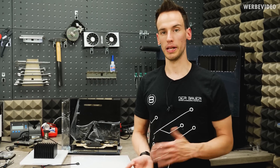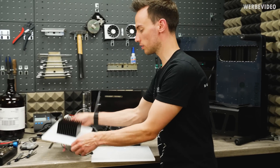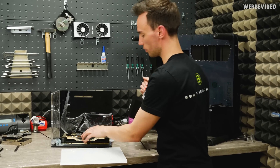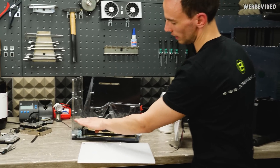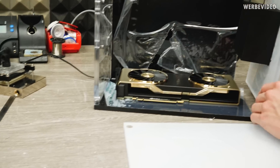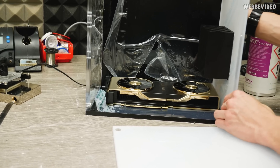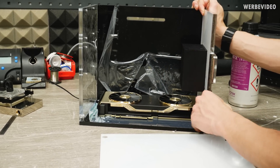We will have the tank here with the Titan RTX inside. It will have a fluid level of about eight to nine centimeters of 3M Novec, and then we will have this element in front, which is used to condense the main part of the gas.